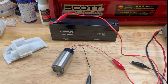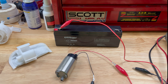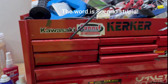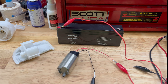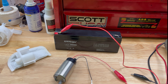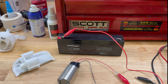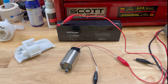So — myth or not? Not really a myth — you can damage the pump if you allow it to continue to run once your fuel tank is empty. In real-world scenarios, the cumulative damage of running your tank dry again and again, even leaving the key on for 15 seconds on a dry tank — I'm not seeing how that's hurting anything. Running your bike low on fuel shouldn't be hurting anything. Obviously running it out of fuel and leaving the pump on will hurt something, but I guess that's up to you guys to decide.